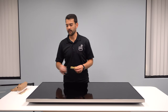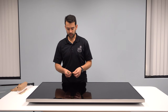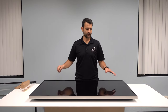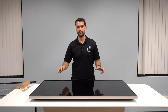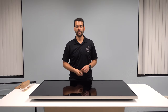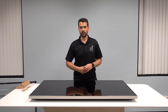The double-sided foam tape that comes with the screen is what we're going to use to attach the frame and the TV together. It comes in long strips. You want to take each of the pieces and put them as close together as possible all around the television. You want to use enough that you're going to ensure the touch frame and glass — which is pretty heavy, especially in the larger sizes — adheres properly. We're going to space at least three to four pieces on the short edge on this 55-inch, and as many as we can fit on the long top and bottom edges. Tape all the way around is the idea, and putting more tape on one edge than another is fine as long as you balance it.